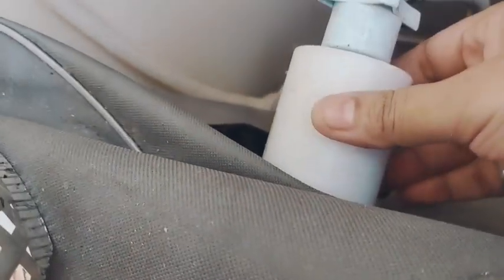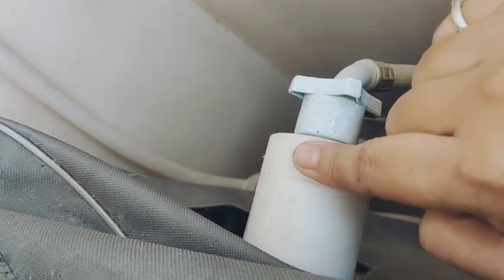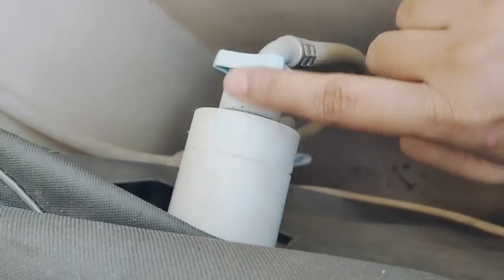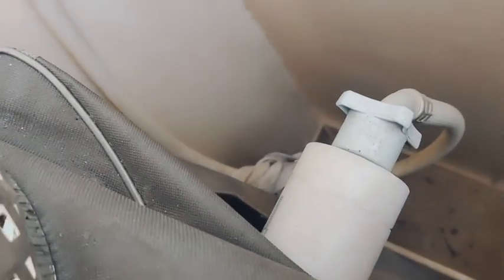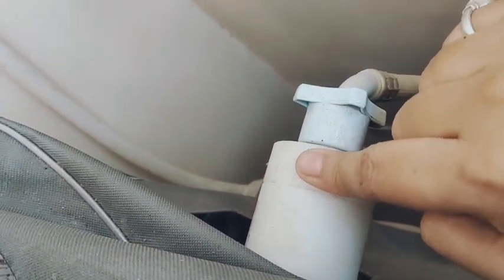After cleaning the drum, the fifth part to clean is the tap-like part at the back from where the water flow comes in. I have a softener attached there so that hard water doesn't damage the machine. I generally get it changed yearly and the mechanic cleans it too. If you open it and check, it has a mesh-like net filter inside — just take it out and clean it.